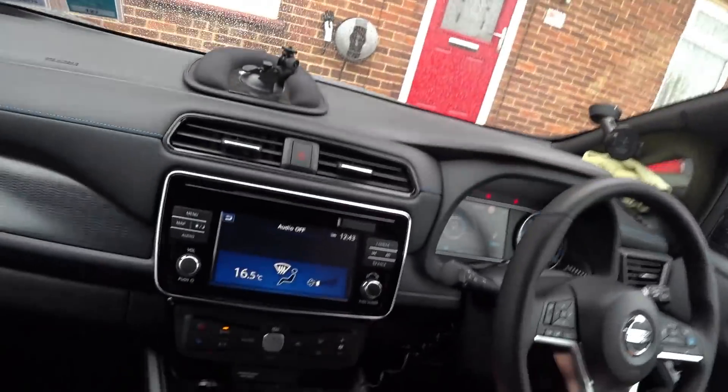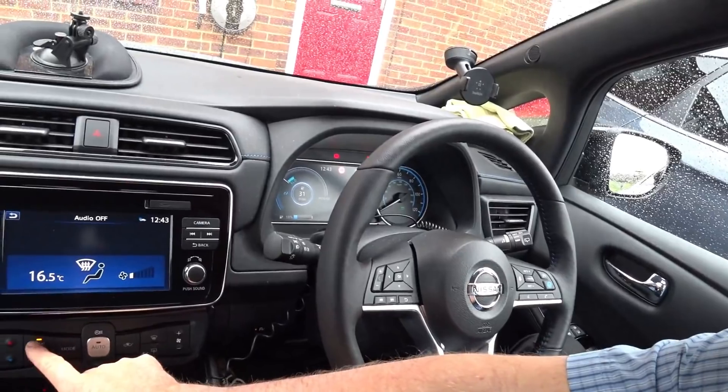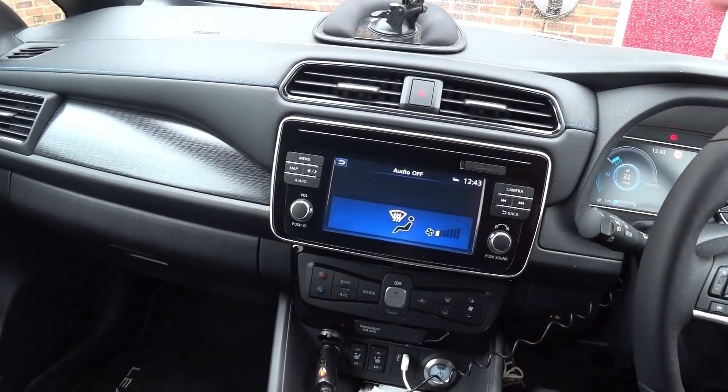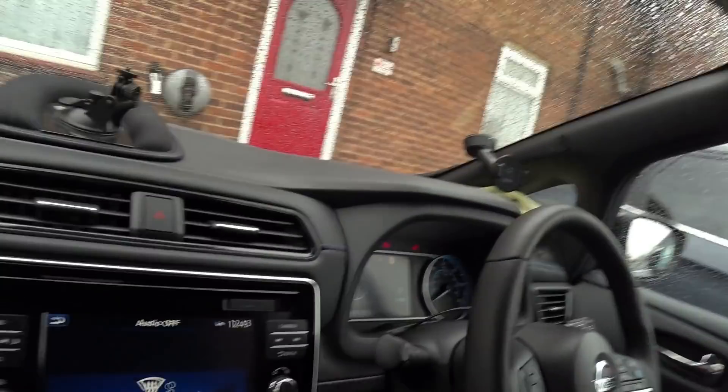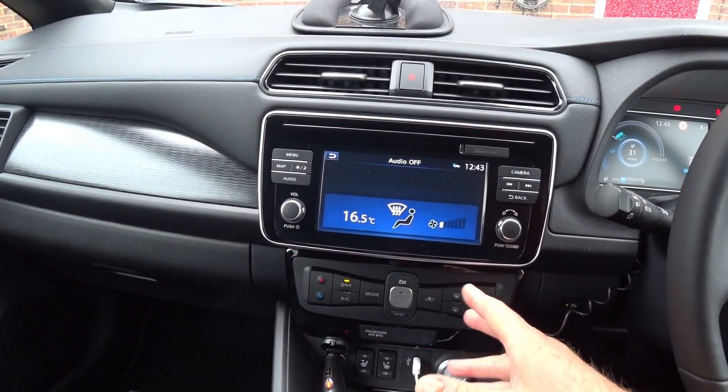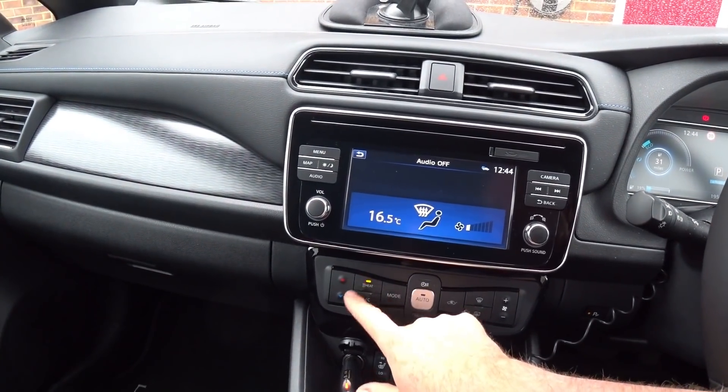Imagine you've got a steering wheel — it's so easy to just pulse this button. Once the car's warm it will actually stay warm for about five minutes. Unlike a traditional car where you'd turn the dial to cold immediately, or one with a heater matrix where outside air passes over it — with the heat pump it stays warm for about five minutes. So you can pulse the heat pump every five to eight minutes depending on what temperature is suitable for you or your passengers.